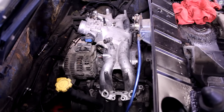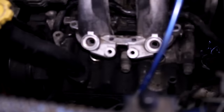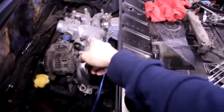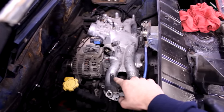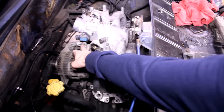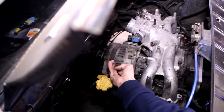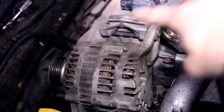I thought I'd bring you guys back real quick — I'm still in the middle of cleaning it, but as you can see it's looking a lot better. There's the intake manifold, though that head in particular is still pretty dirty. I wanted to show you the alternator setup: since the alternator was right in the middle and I'm doing this intake manifold flip, I do have to relocate the alternator. This is the stock alternator bracket, but normally it's flipped over to the other side — so if it could go all the way around, that's where it goes from the factory.